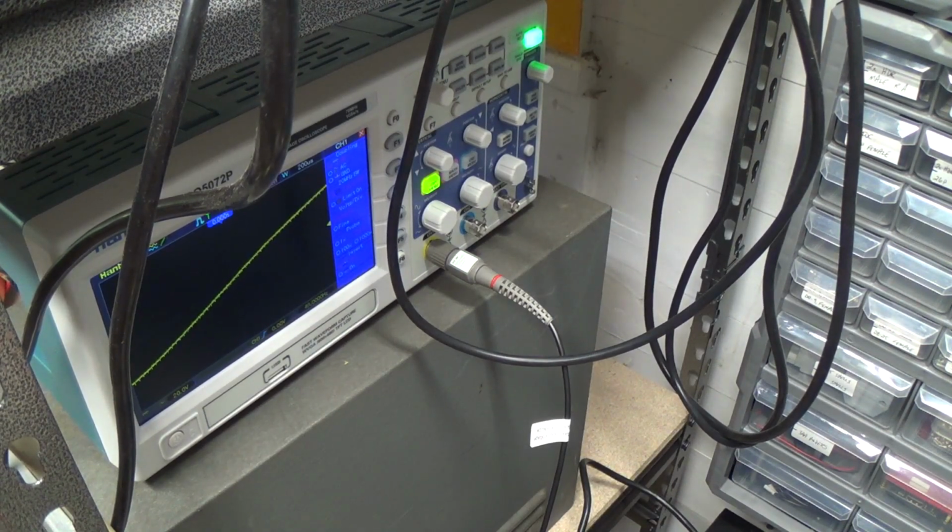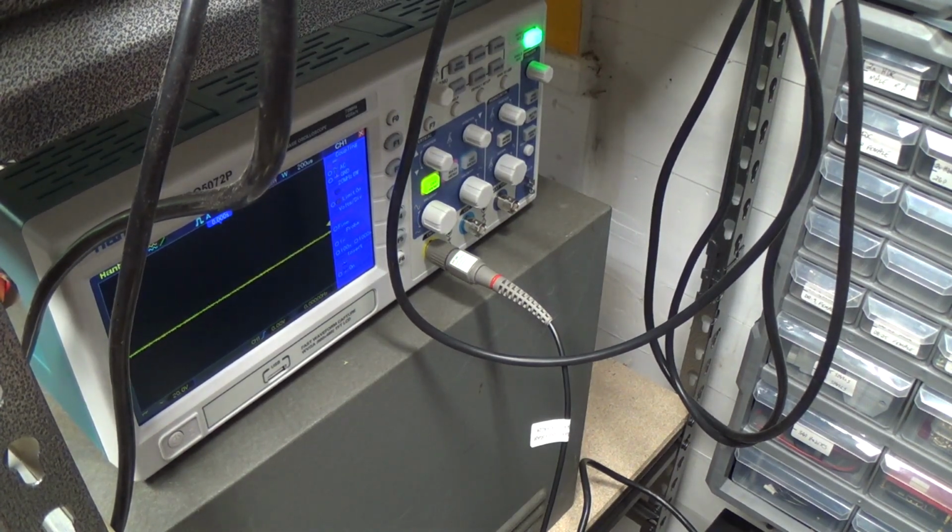So when I connect the ground of the probe to the frame of the terminal, I seem to get this weird transient voltage on the probe. However, when I hook the probe ground to the signal ground on the DB25 connector, it levels out. And when I touch the frame, it doesn't shock me, but it's certainly acting like there might be AC leaking in somewhere or something.